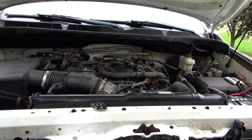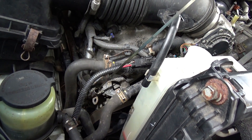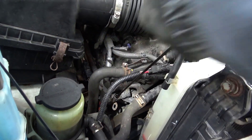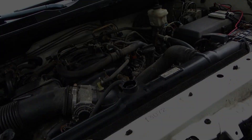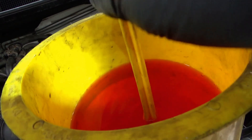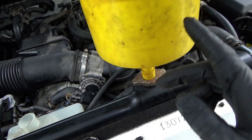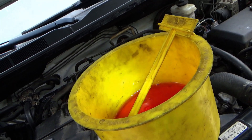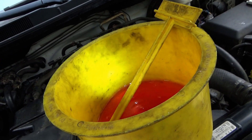Before the final test drive, let's do a quick fluids check. Engine oil looks clean and fine. However, the coolant was empty — opened the radiator cap and there's nothing in here. Come on, people — basic maintenance. Let's see how thirsty the Sequoia is. We'll let it bubble until it's full, then fill it up. Coolant probably hasn't been checked since 2012.